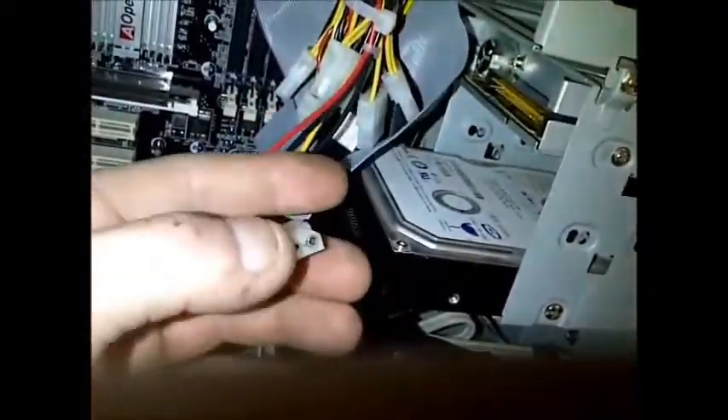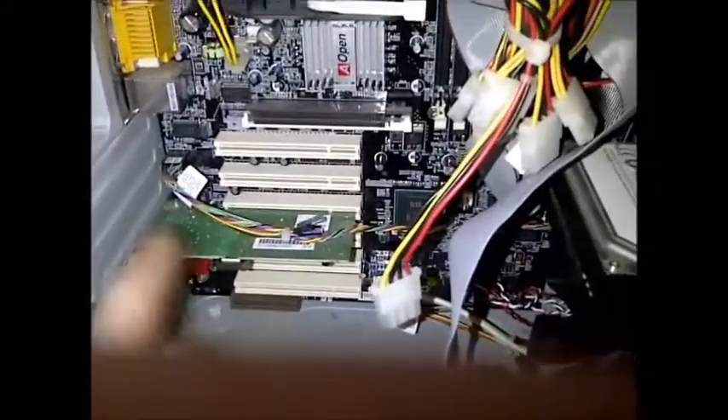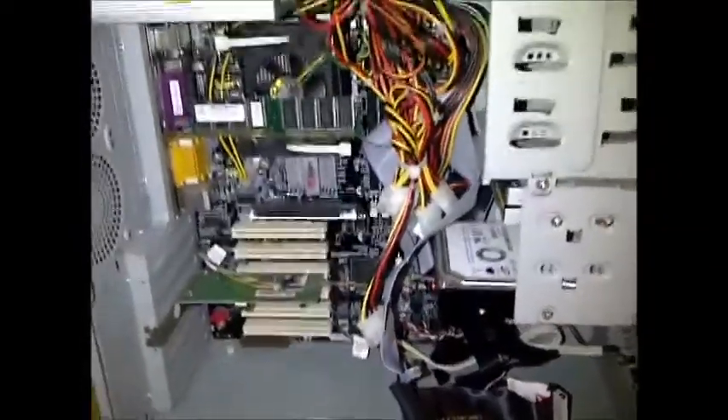You may find that one of your cards is actually shorted out. I actually had a power connector swing down and touch two solder points — big blue spark. Luckily it only fried a network card, but learn from that: keep your power cables tucked out of the way.